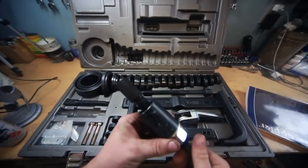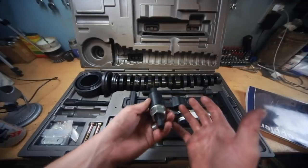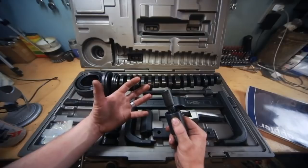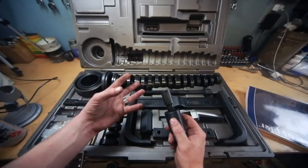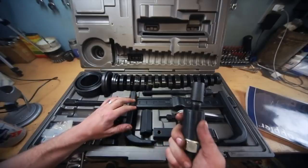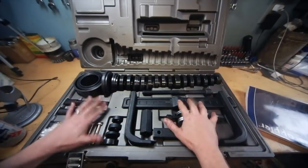These are in the kit I've been using and they're designed for pulling the axle back through the hub after installation. It shouldn't be that hard to pull the axle through the hub — if it is, it's generally because there's a lot of corrosion. I don't know why you wouldn't just hit it with a wire wheel and some anti-seize, which is what I normally do and then it goes right through. I've never had to actually use this unit, but I've got it now just in case.